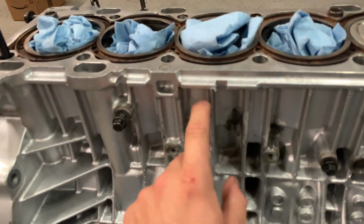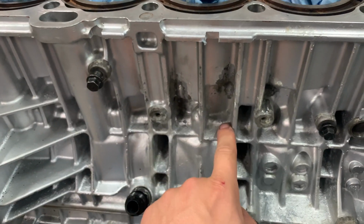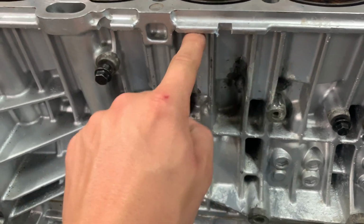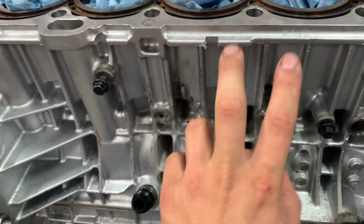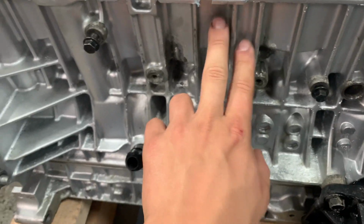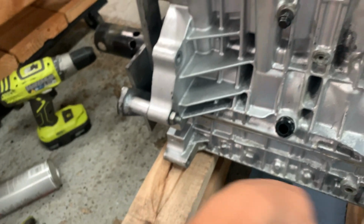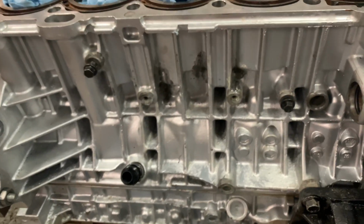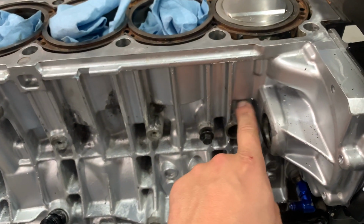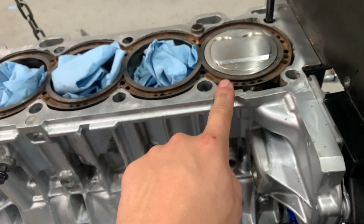And if we don't, we're gonna drain it back out, let it dry, and then I ordered some other aluminum epoxy that we are gonna use to basically fill in the ribbing here and here and here, and probably just this area, because this is really the only area that cracked. I don't think anything else is gonna crack, hopefully not, knock on wood, when we switch back to torque-to-yield stretch bolts. I might also put a little bit around here and on this side, because this is where I drilled the hole.